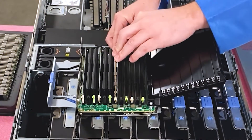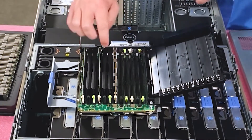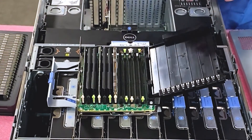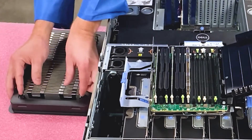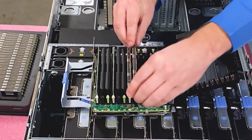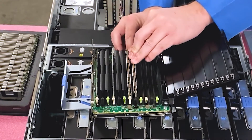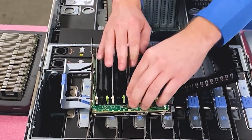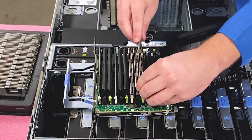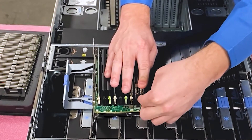It literally just clicks in — you'll even hear the little click as it goes in. Make sure the tabs go perfectly in on each side and you just load it up. I'll do a couple of them real quick just to show you how easy it is. The nice thing about RAM is that you can load up a riser in probably four to five minutes and knock out this whole machine pretty quick. You're getting a huge boost in performance for minimal effort — I'm a big fan of that.